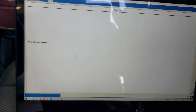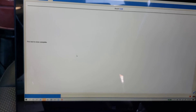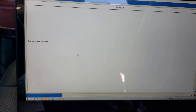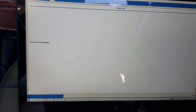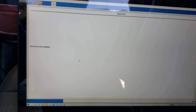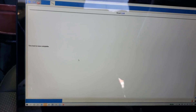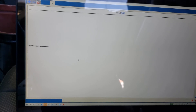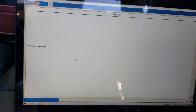Now we're going to start it. We've got to learn the idle, so we're going to let it idle for five to ten minutes in park. Then we'll put it in gear with our foot on the brake and let it idle for maybe five minutes. Then we'll turn the AC on and let it idle. After that's done, we'll take it out for a drive, make sure everything's good, and verify our repair is complete.